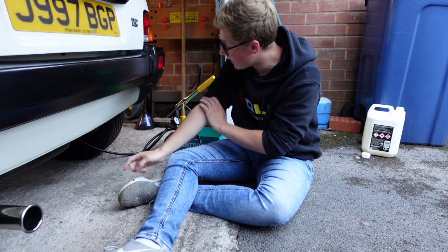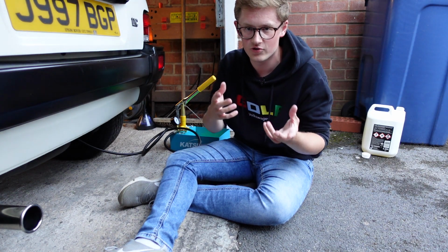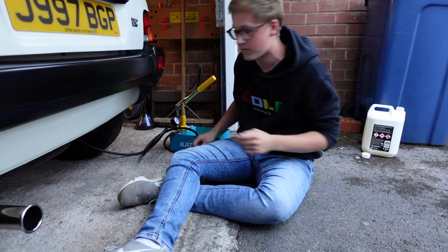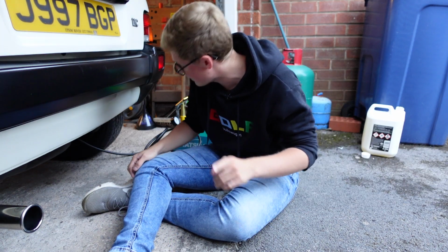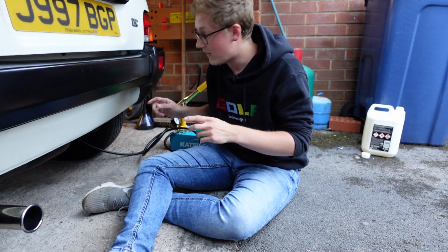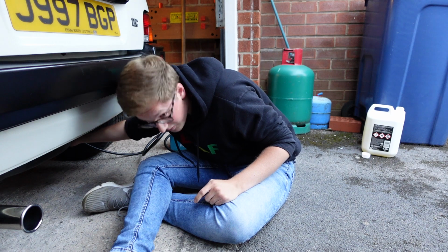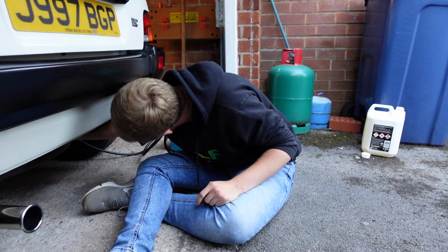So the little T-bar on the actual Schrader valve itself should be turned out. You should have done that before you put it on, and just make sure that the fluid, of course, was getting through. I should have mentioned those things, but I assume you're not doing it along with the video the first time you watch it. So now we actually need to get into the suspension, so we need to turn that T-bar around clockwise and hope it doesn't explode.